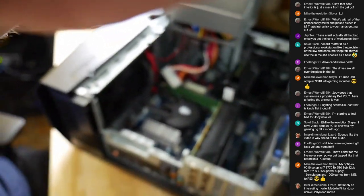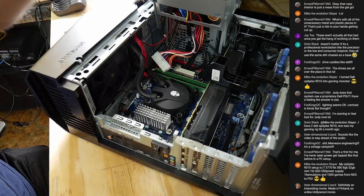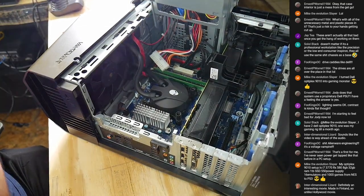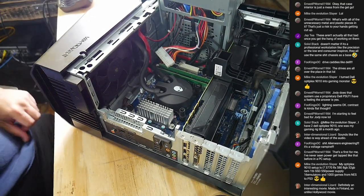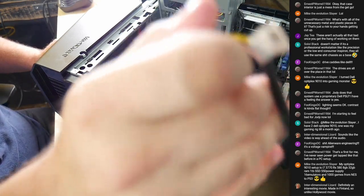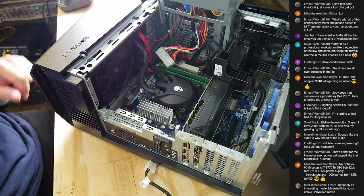This thing has water cooling. I swear to God, it has water cooling, and it has a tap that taps off the main motherboard for 12 volts. You can't make this shit up, people. You can't make this shit up. That means that it doesn't deliver the extra 12 volts the CPU needs separately. It just drains what comes in on here. And you know what? Maybe that's fine.